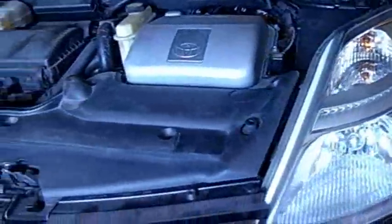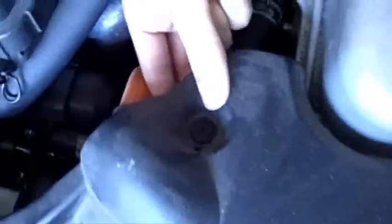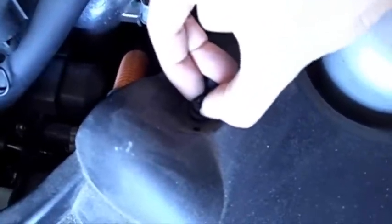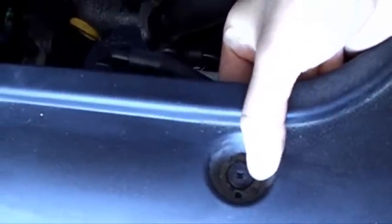The first thing I'm going to do to change the coolant for the inverter is right here, and the coolant pump is down there. I'm going to have to first remove this plastic panel. The trick to it is just get your finger underneath, push it out. The screw part came out so you can just wiggle and take it out. I find that easier than unscrewing the whole thing.